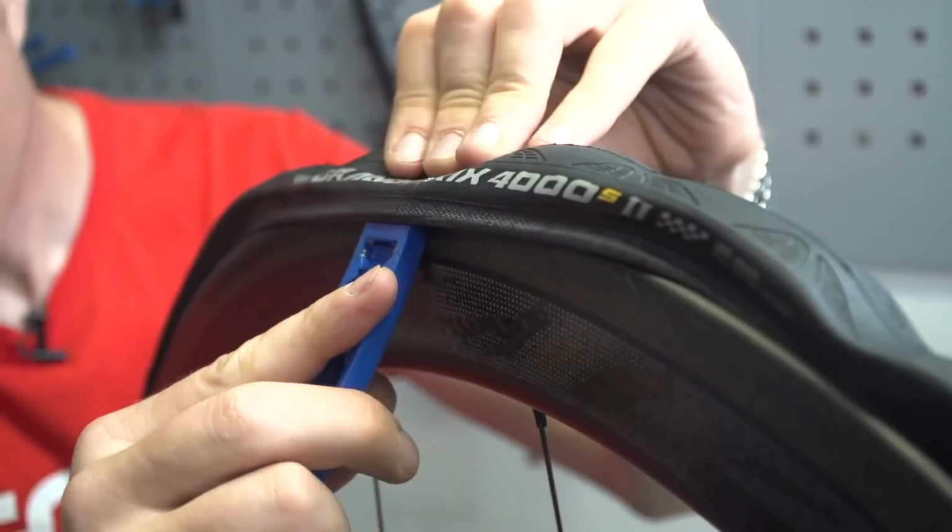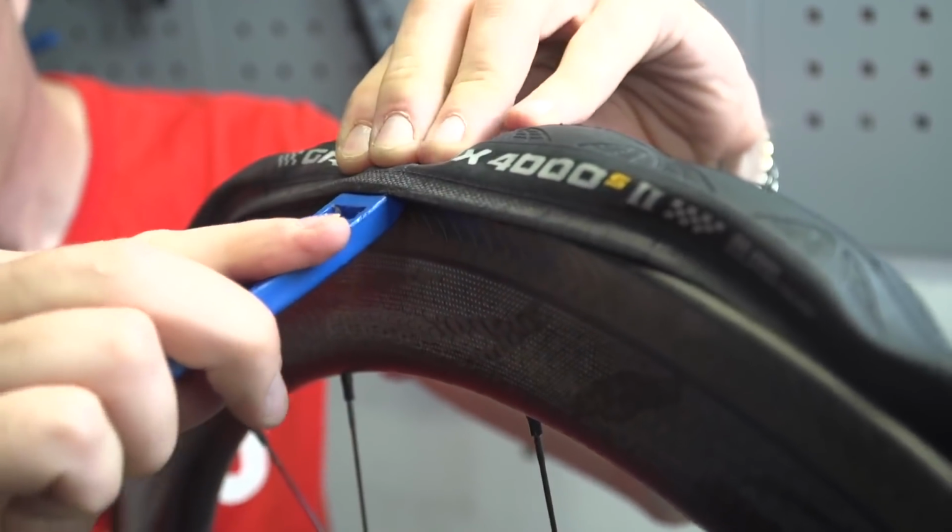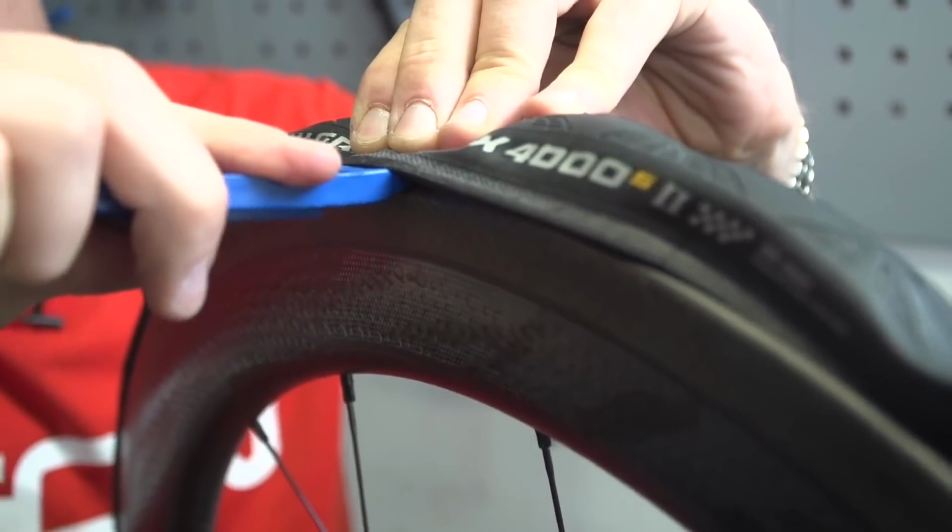Right then, Sepa, exactly the same method as you would use on normal wheels, but something to consider: if you're using metal tyre levers, or the really old-fashioned method of using some old spoons underneath the tyre bead to get them off, don't do that, because it could in fact score a carbon fibre rim. Instead, use some plastic levers. Method exactly the same though, nothing special, there's no wizardry involved with that.